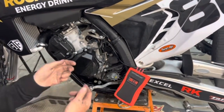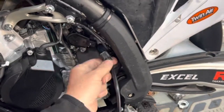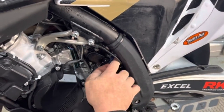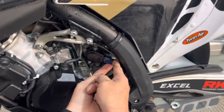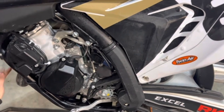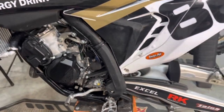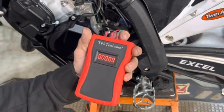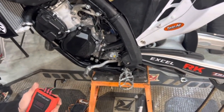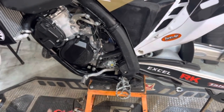We can go ahead and put the throttle pipe back together. Turn this off and disconnect the dongle — it just pulls off, pull back on it. The stock connector goes back in here and snaps into place. That's all she wrote — button it all back together and we'll test fire it a little bit later. I get a lot of comments on how to actually do this — that's how you do it in the shop, not at the dealer. To do this accurately you need the tpstool.com unit — about $140-$150, ships from Amazon — plus a T27 Torx to loosen those two nuts and an 8mm to take off your throttle pipe. God bless, we'll do more soon.